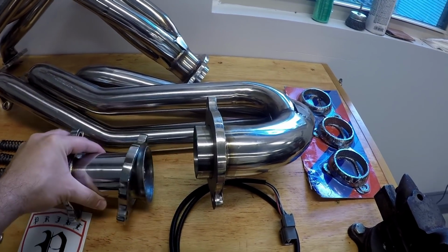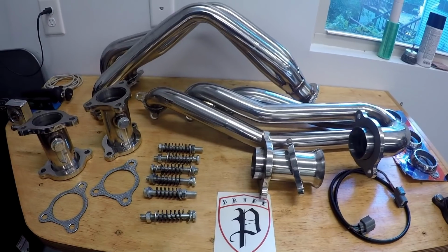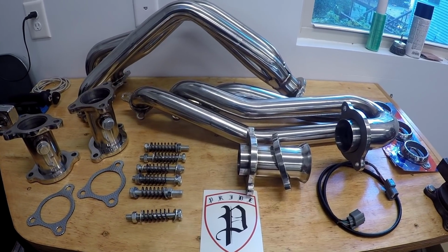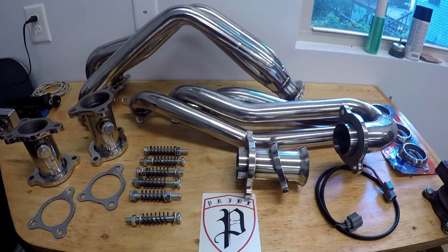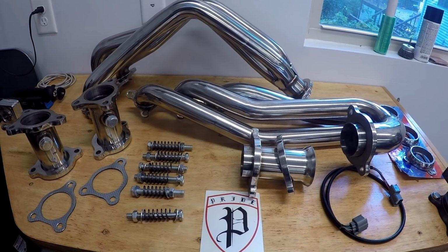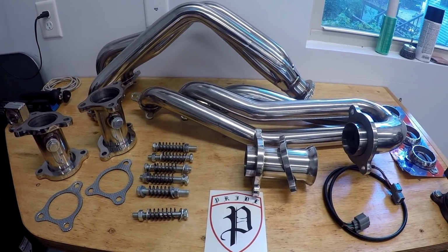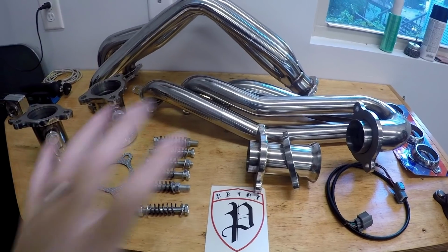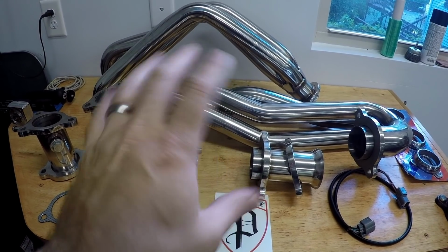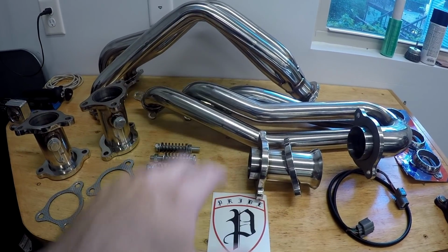as far as your ability for this thing to rotate a little bit and position itself. It does two things, really. It matches up to the inevitable fudge factor of where things are positioned in any individual car, which exhaust setup you have, and how that angles the catalytic converters. It also accounts for the tailpipe sections being fixed to the chassis and body of the car, while the engine is on rubber mounts. The engine will torque a little as you rev it or apply engine braking, tilting one way or the other, and you need a flexible joint that allows some wiggle there.